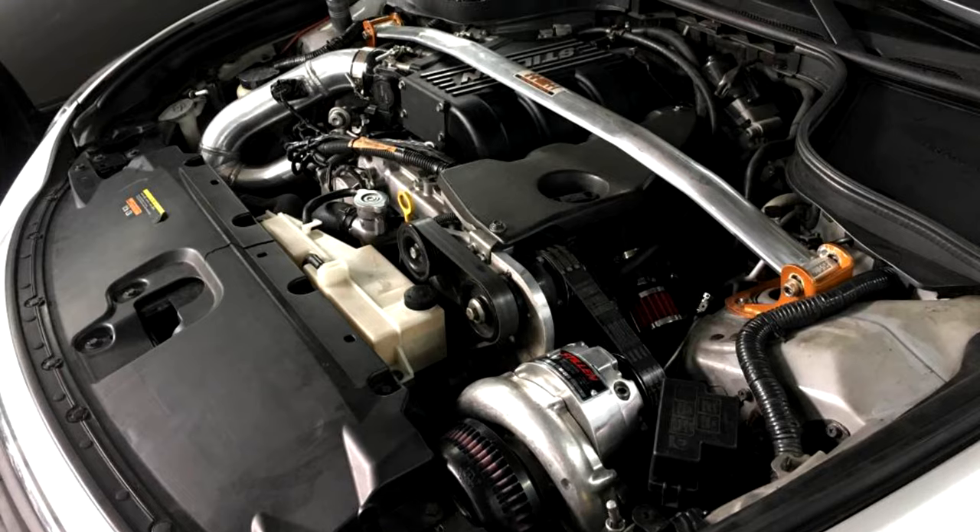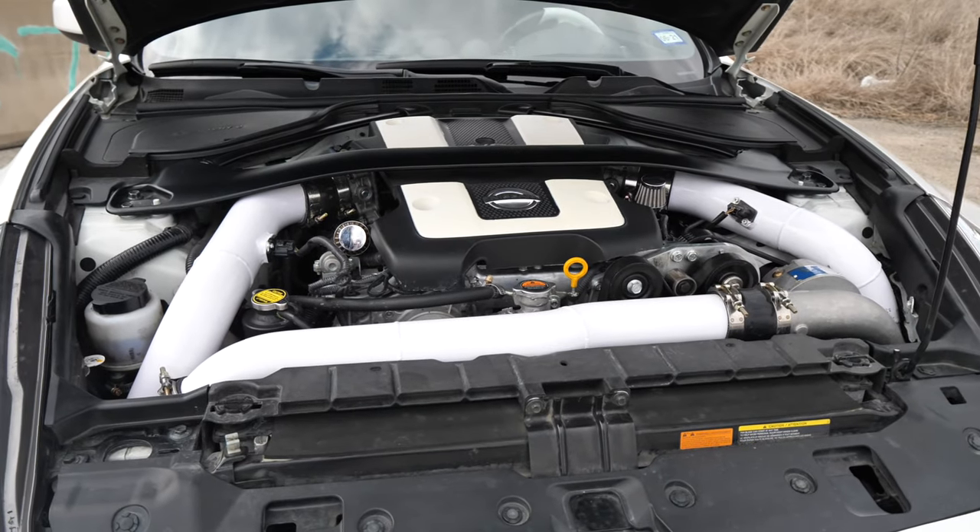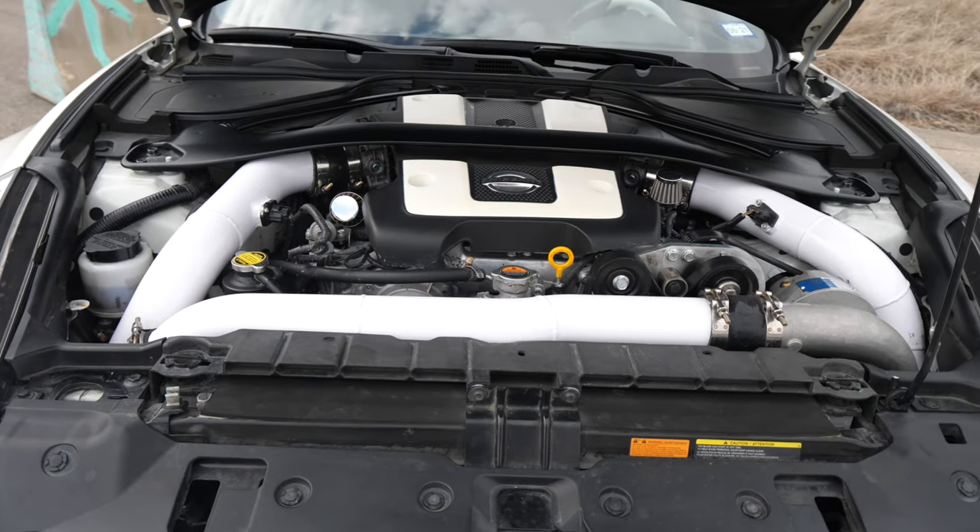To give you a little background on Top Guns kits from past to present: the original supercharger kit was essentially an air-to-air conversion of the Stillen kit that also integrated the nine-pound pulley. This meant we could make more boost than the original Stillen kit, and the air-to-air conversion gave us more power potential as well. It was fairly revolutionary for this platform — the lowest cost supercharger kit on the market, made more power than the original Stillen kit, and was cheaper. Back in November 2019, he then announced the ACE kit, which is what I'm currently running. This kit integrated the factory manifold, cutting down installation time and giving us cooler intake temperatures due to less heat soak from the Stillen manifold. The stock manifold also flows a little bit better.